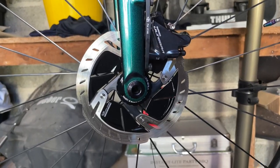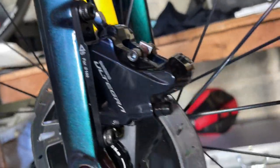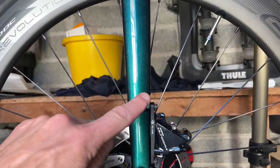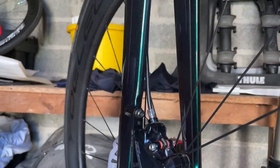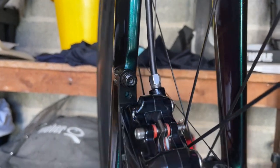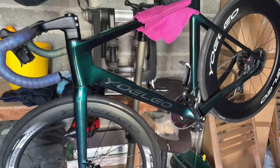Having played with this a number of times, there's probably a millimeter to play with in there. When I undo the bolts, because I don't have a lot of slack on this hydraulic cable, it twists the caliper. That is a problem of my own design — not leaving enough slack in the hydraulic cable. Even when the wheel is turned, if I let it go it pulls straight, so there's virtually no slack at all. That's my own fault for cutting it too short — I didn't know I was going to change to 140mm, so for 160mm it was fine. Thanks for watching, thanks for subscribing, and we'll see you on the next Carus House — take care, bye.